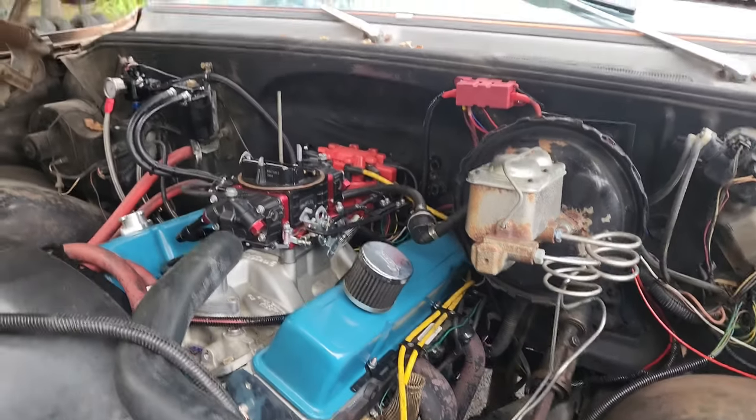Another one I've heard is that these are throwaway heads — you run them for a race or two and then they're trash. Not the case. I've had these on there for just over a year, driven them from Jersey all the way to West Virginia, down to Virginia, up to Pennsylvania, all throughout Maryland, and I've probably put about 7,000 miles on them. I've done quite a few oil changes — a little more than regular since it was a fresh build — no metals in the oil, no issues at all. Don't let anybody say they don't last, because they do.